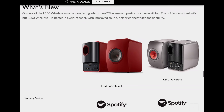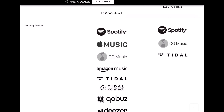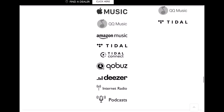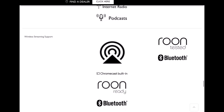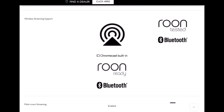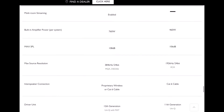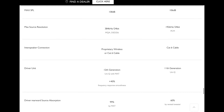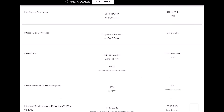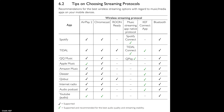There are also several other upgrades compared to the original LS50 Wireless. These are Roon ready, have Chromecast built in, support Apple AirPlay 2, and also support MQA and DSD256 for higher-resolution formats. They play high-res content up to 384kHz at 24-bit, compared to 192kHz at 24-bit on the original. They also support more streaming services — not just Spotify and Tidal, but also Qobuz, Deezer, Amazon Music, and Apple Music, all within the app.